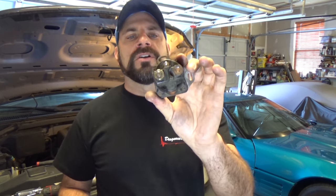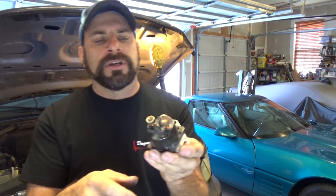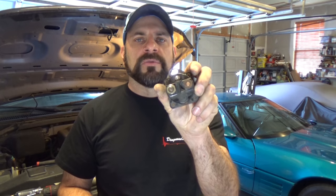Hopefully this video helped you out if you're having a no-crank situation with your Ford. Don't forget the starter solenoid here — this one was intermittent and I couldn't catch it on film. But if you go ahead and take your test light, go to the control wire, and it's glowing nice and bright when the key's turned, try that screwdriver jump trick — just tap it across there, and if it cranks, you've got a good indication of what's going on. You do want to do voltage drop tests too. This is like you're on the side of the road and you just need to go. Check out the video of the starter replacement I did — I'll leave a link in the description — where I do those voltage drop tests and prove that the starter's bad. Anyway, I showed you the BWD garbage and how the new Motorcraft was clacketing real good.